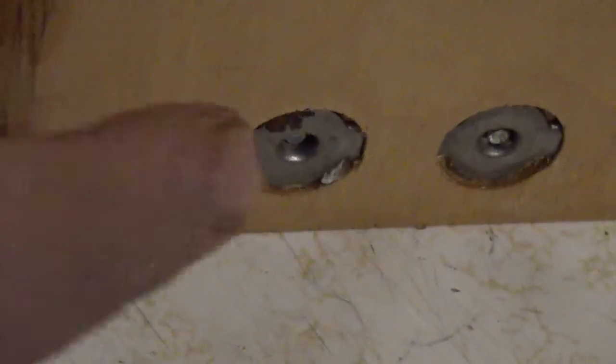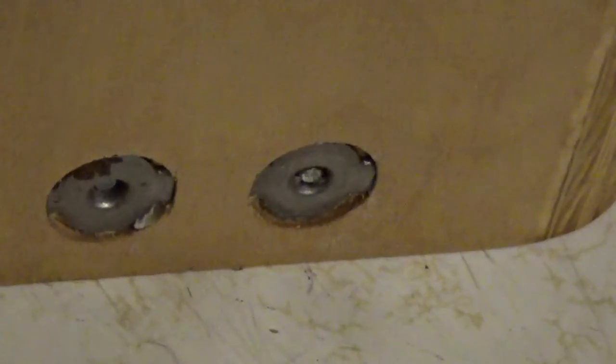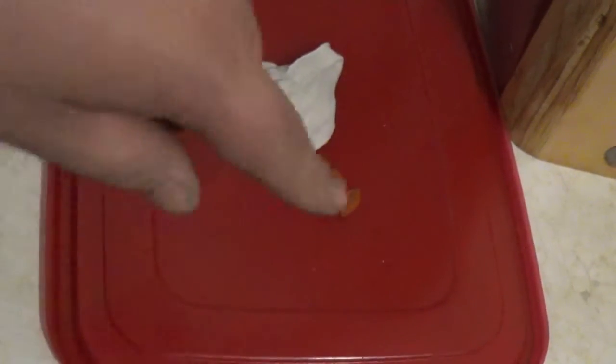Williams control panels have a divot right here and right here on the very bottom — and also on the top. The original overlay is a stiffer overlay than the replacement overlay I'm going to put in. So what I'm going to do is mix some automotive body filler and hardener — like Bondo — and I'm going to fill these divots in. Because the new overlay isn't as stiff as the original.